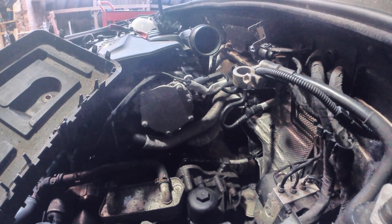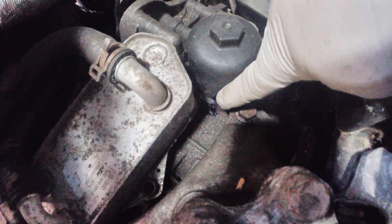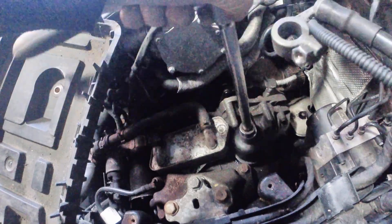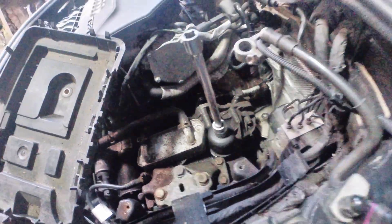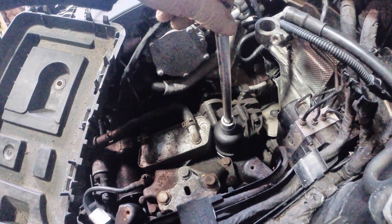What I've done to show you guys is mark it so you could torque it up to spec, or just leave a mark so when you tighten it back it comes back to that mark. It's going to get a little messy, so put the camera down and get your bucket before you take this off.